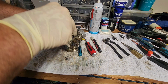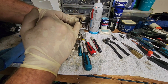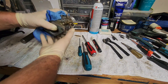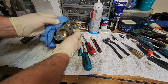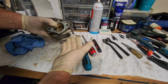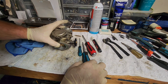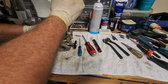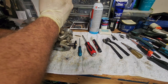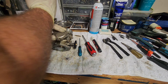Taking the fuel filter out — a lot of times this will have little minor fragments of stuff in it, you always want to get that out of there. We're going to turn this over and get all that extra fuel out. You want to be careful because if there's anything sitting on this side that might be bent, and if you have to use an impact driver you want to be careful about that. You can start from either side. The fuel pump side is pretty simple; this side has a few more items — obviously the jets and everything.